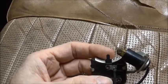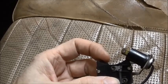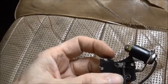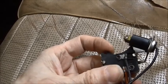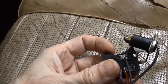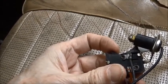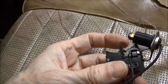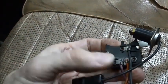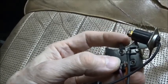The plastic piece in the center engages knobs on the steering column. As you make a right turn or a left turn, it will knock this over, and so long as you're turning in one direction it'll hold it. That completes a circuit and your turn signal is activated.